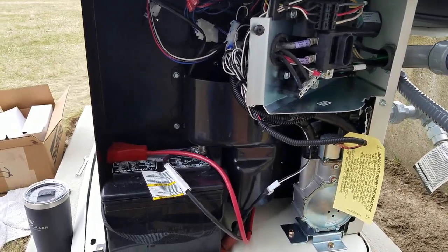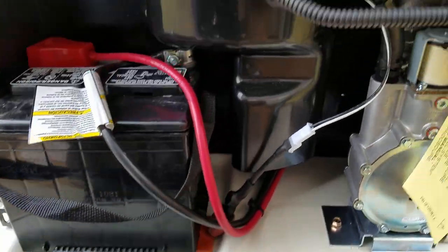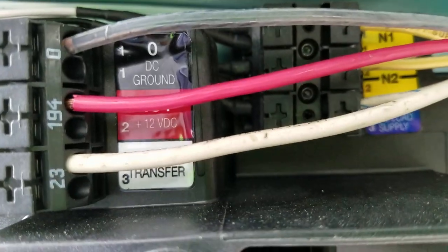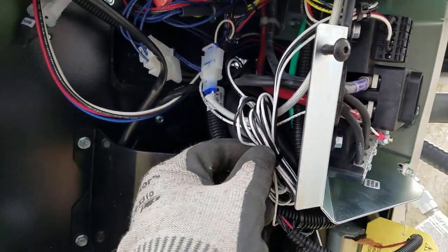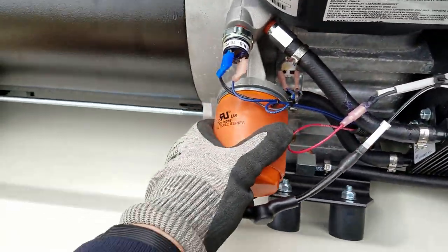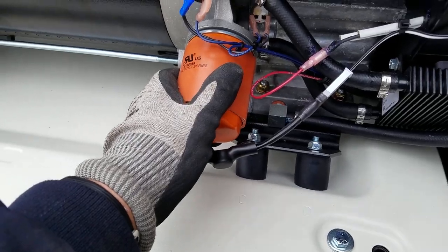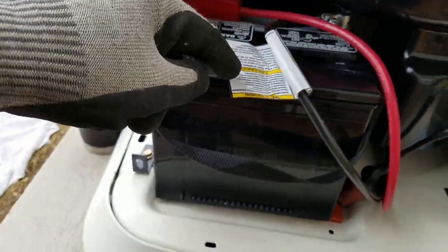Putting in the battery and the battery warmer and the wiring — kind of a pain to get to. You've got to hook up N1 and N2 back there, really hard to get to. Pull the fuses on the inside so you don't short anything out. Wiring ran through the firewall. For the oil filter heater — there's a little automatic thermostat on it, and the little filter heater is on. Put the battery this way because I had it the other way and the wires were all out by the door and I didn't really like it.